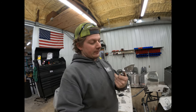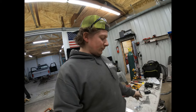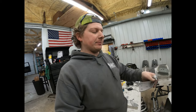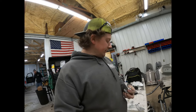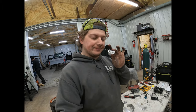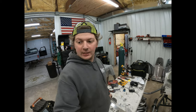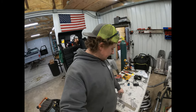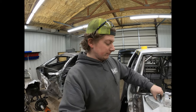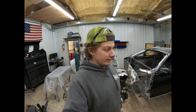So the slotted one is gonna go on the bottom because when the door turns and hits these slots is when you can pick the door up off the hinge. Otherwise, when it's not lined up with that, it won't pick up. And then this top one, the hinge for the door just has a little ball cup in it, and it will just sit on that ball. But anyway, we're gonna get this situated over here. I'm just using the factory bolts, so gonna get started on this and hopefully get it hung and fit.